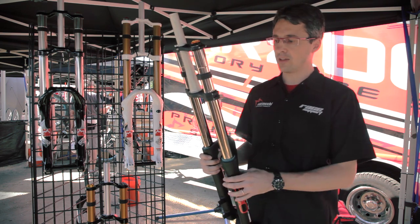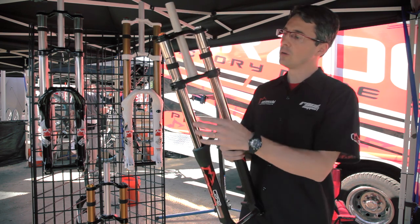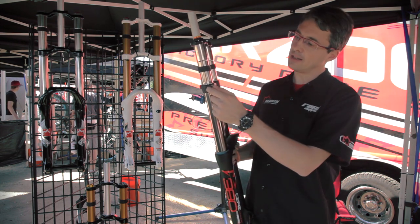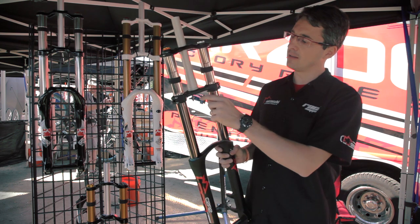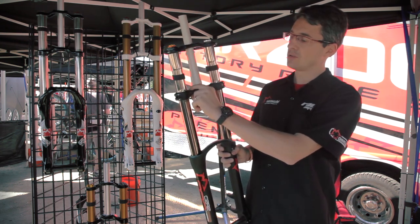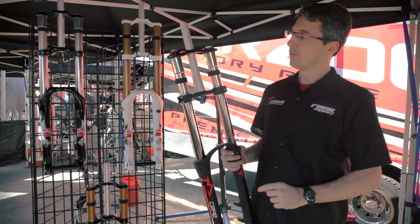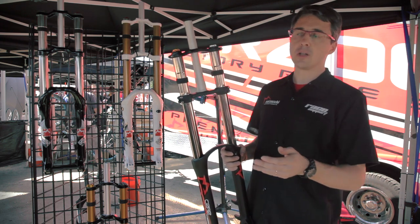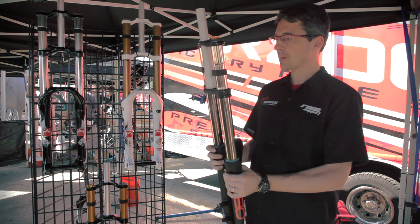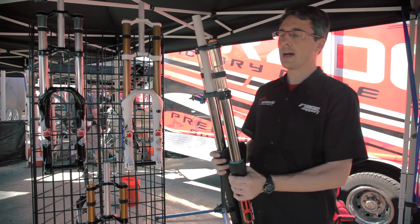There is a new seal kit — an SKF-designed special low-friction seal for the new fork to improve smoothness and the feel of the fork. The new lower crown design uses drilling and machining: through this point the crown is hollow inside to save weight.